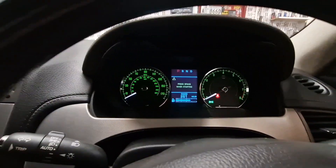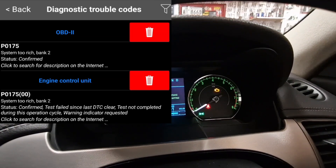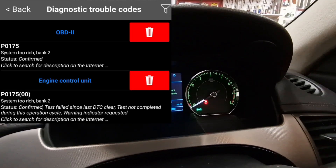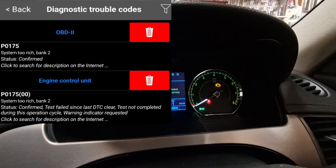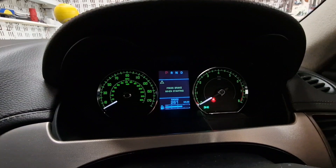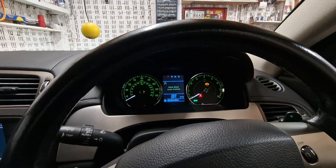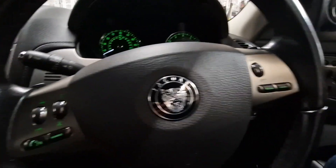You can see it's flashing now because it's sending data. The diagnostic EML light is flashing on and off — that's because it's started to communicate with my phone and is pulling the data in. Once you've finished, you basically turn the ignition off and take your adapter out.